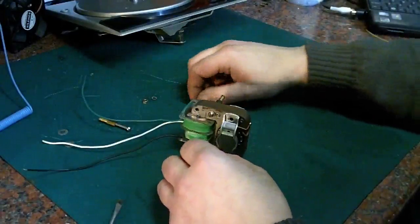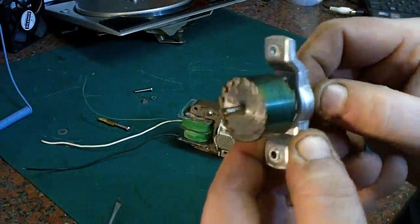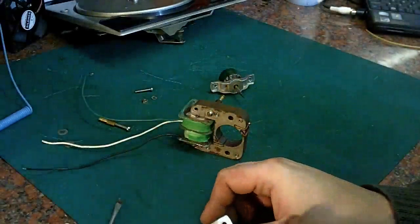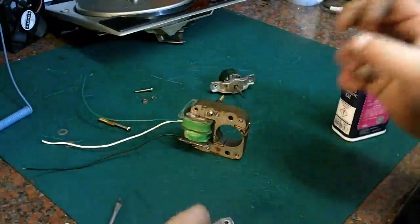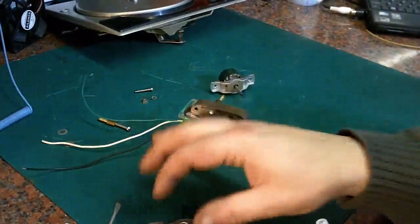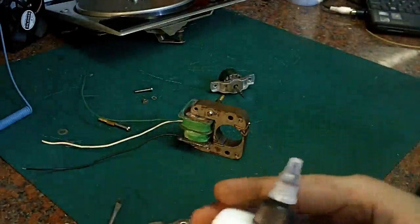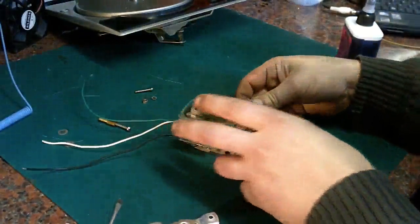We take them out and give that a pull — we can take the rotor out there. We'll want to oil that top motor bush in there, but we'll do that after. First we'll do the bottom one — we'll pull that free. There's a little bush in there. Now these are sintered bronze bushes. Really what you need to do is get them hot and then drop them in oil so the oil soaks into the bearing. But if you don't want to do that, you can just use a little bit of oil to lubricate them and it will soak in a little bit. This is sewing machine oil — I find it's fairly good for lubricating everything on old record players. All we want to do is put literally one little drop in there.